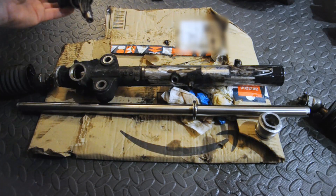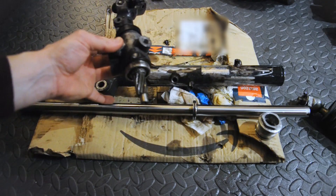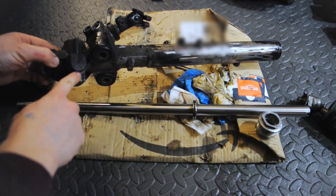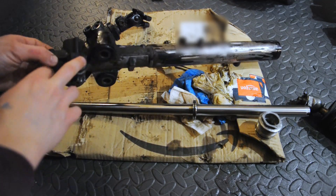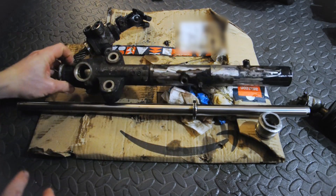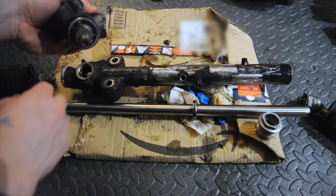When you're taking this gear out — which you have to do before the centre of the rack will pull out — that's slightly different as well. On the Mark 1 rack there's a little cover here and then some bolts. On this it's just blanked off, so there's nothing on that side. It's all on this side; there are a couple of bolts that go through these holes and into there.